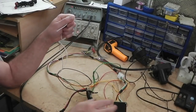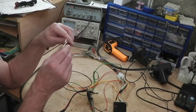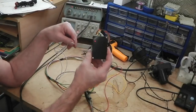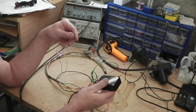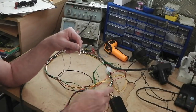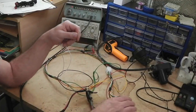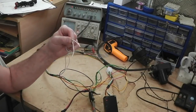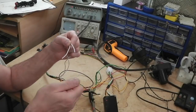That way, if the gearbox solenoid developed a fault and it kept blowing this fuse, you'd know that the fault was the gearbox solenoid and not the fuse on this. If this developed a fault and blew its fuse and this was deriving its power from that box, you wouldn't know if it was the gearbox that was popping the fuse or this module. So by keeping the supply independent, 12 volts in,